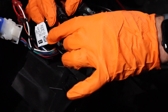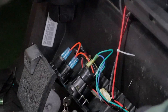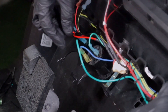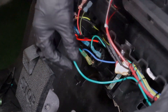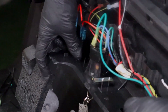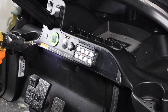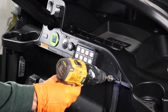Attach the state of charge meter wiring harness to the back of the state of charge meter. Route the green wire from the 12V reducer to the key switch, and using a dual spade connector or wire jumper, attach the 12V reducer's green wire to the cart's blue wire on the key switch, which is the cold side. So when the key switch is in the on position, the 12V supply is activated. Secure excess wire behind the dash and secure the dash panel back in place.